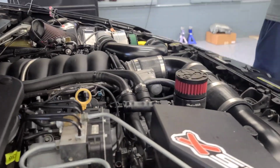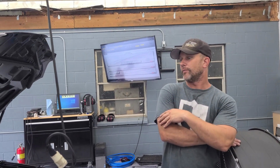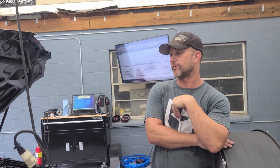We're working on too. We're using my car as a test bed. We're doing a fuel system. We're going to have a fuel system that fits that recipe. Like, hey, I want 900, 1,000 horsepower. Cool. We're doing the Radium bucket in my car with two 455 pumps. The second pump will come on a Hobbs switch with boost.